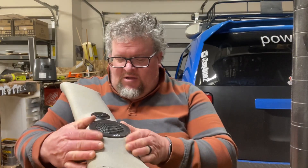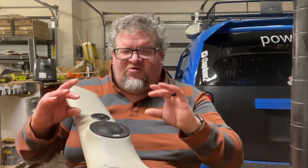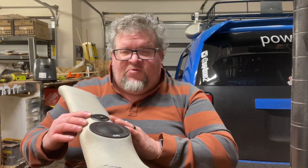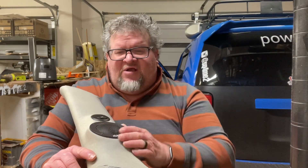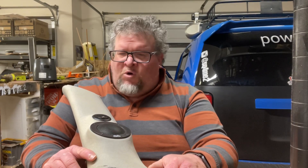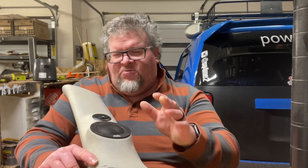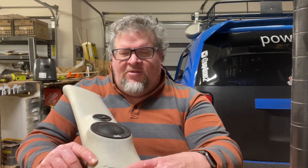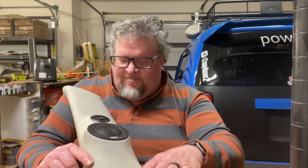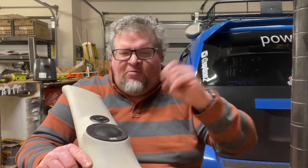In addition to the new construction technique, I'm also going to do away with the exposed sexy lens look. I want to flush the speakers into a countersunk pod — same with the tweeter — and I'll try to bring some tweeter lines in, but probably not as prevalent as before. I'm going to have a grill going across it with a black grill cloth. I wouldn't mind being able to see the speaker just a little bit through the grill — I have grill material similar to what's in the front scoop of the car's hood that I'm probably going to use.